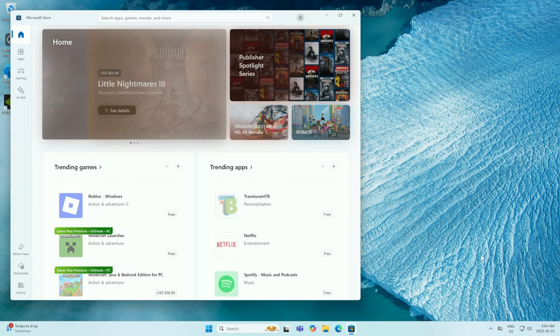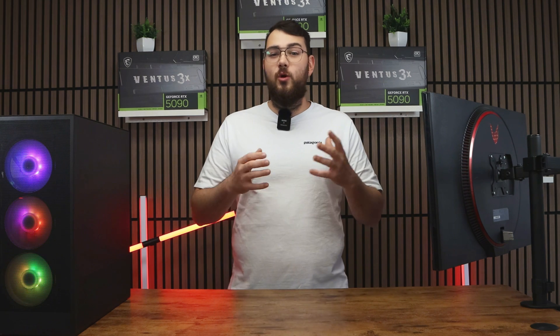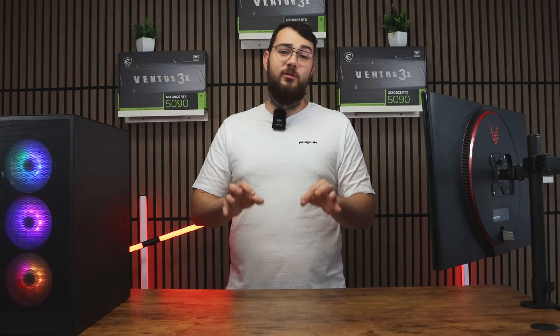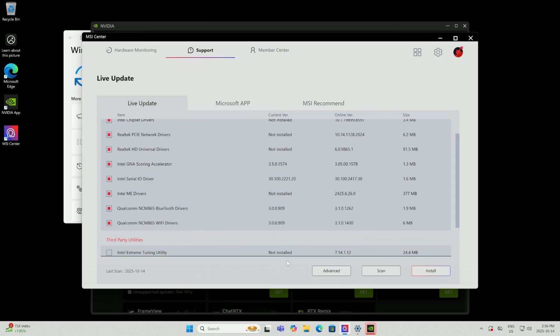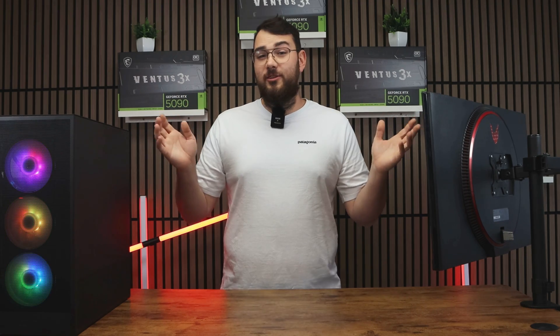Step one: go to the Microsoft Store and search for MSI Center, then click Install. Once MSI Center is open, click the Support tab at the top and go to Live Update. Even though this part isn't directly about the BIOS, I recommend checking for any missing drivers first — click Scan Now and install any updates it finds. Do yourself a favor and avoid any utilities or tools; stick to drivers only, as most of the other stuff is just unnecessary bloatware.